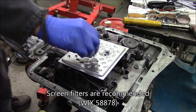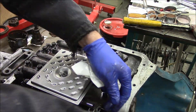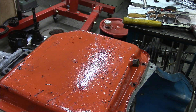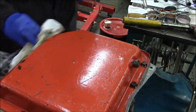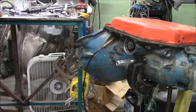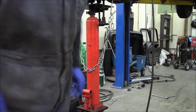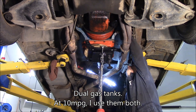We've got the screen filters — I've used the paper type filter, but screen ones seem to be the most recommended for these. Got the detent cable attached, making sure it shifts into all the gears properly, then we can button this thing up. Cork gaskets are recommended for sealing the best. I've also carefully flattened the flange of this transmission pan. I debated painting the whole thing one nice color, but this crazy thing on the side cushions the application of second gear or intermediate. Then torque a whole bunch of times because gaskets are like that. If you like the transmission stand, I'll leave a link in the description to plans where you can build your own — I've made quite a few transmission stands, and this one is my favorite.